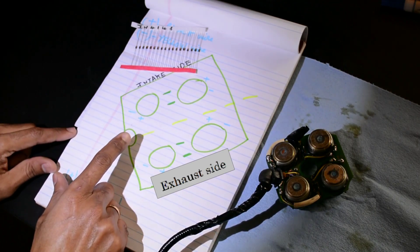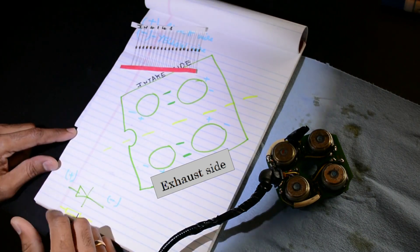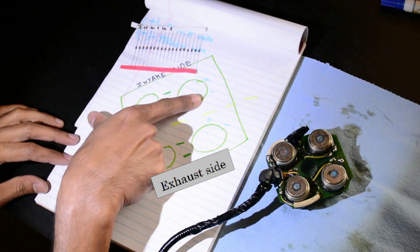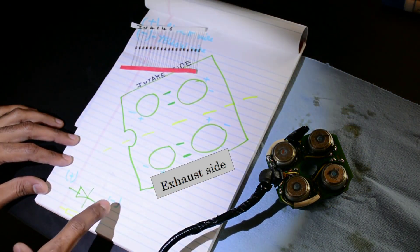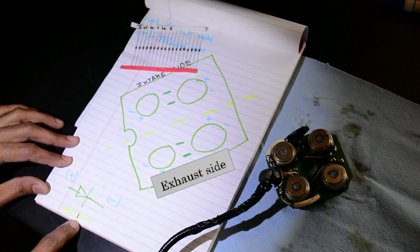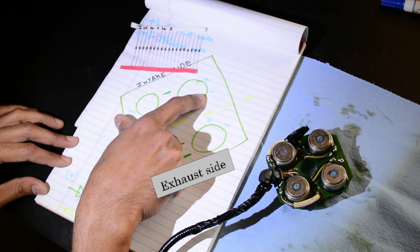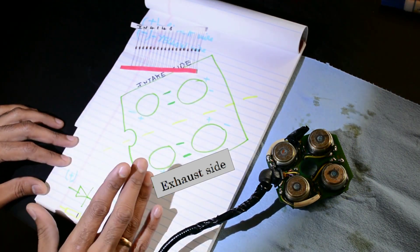I will be performing the diode repair while also swapping the two solenoids. When you repair or replace any of these diodes, make sure you align the polarity correctly. In this case, the solenoid has a positive and a negative side. The cathode side of the diode — which has the negative marking — goes to the positive of the solenoid. If you do it the other way, you are technically short-circuiting the whole circuit. Be very cautious when you solder this.